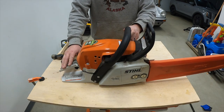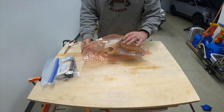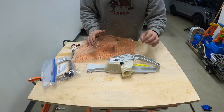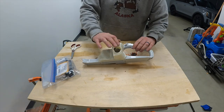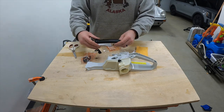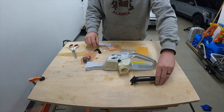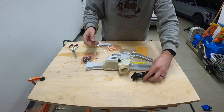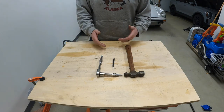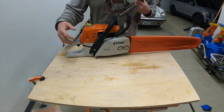So I went to the store and asked what it would cost to replace it — turns out with labor it was the same price as a brand new chainsaw. So I bought a new one. I now have two Farm Boss 271s, but I also bought just the parts to try to fix it myself. The pieces I need include the handle, but the handle encapsulates most of the chainsaw — it's called the fuel tank assembly. To break it down I'll need a T27 Torx bit, a hammer, and a punch.